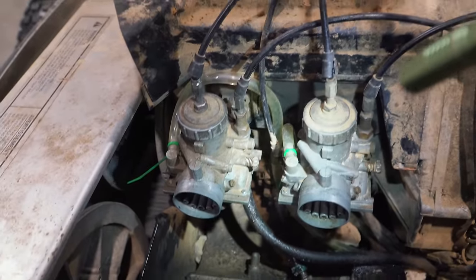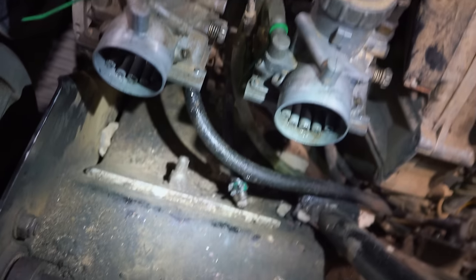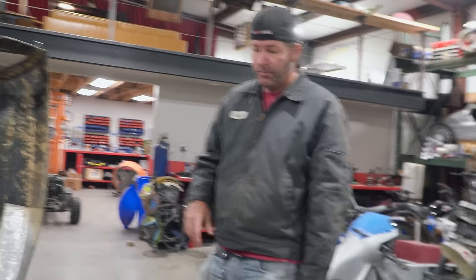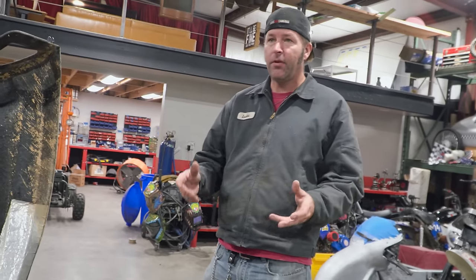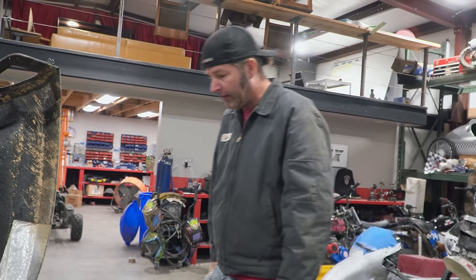That's the one you rebuilt. It's the line. No, it's okay. Which line? The black line. That's a pulse pump. Is that oil? It might be just oil. Well, that could affect how well the pulse pump works. Do you want to pull that line and maybe replace it? Yeah, we'll pull that line and replace it, because I've noticed that the fuel delivery is not that great. And so if there's a hole in the line, the pulse isn't that strong. All right. Cool. Let's take care of that.